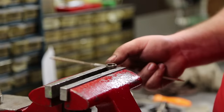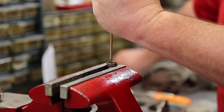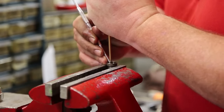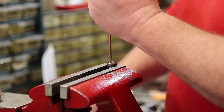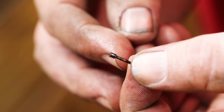But very light pressure. Pretty easily depress the spring by hand. Really need a second pick. Scoot the head of that pintle over. Right there. Nobody move. That's it. That's the pintle out of the nozzle.